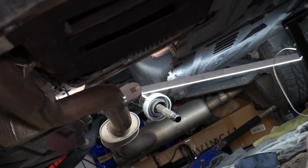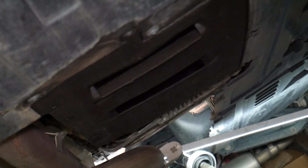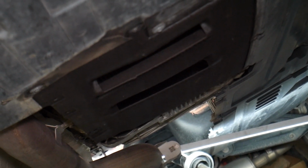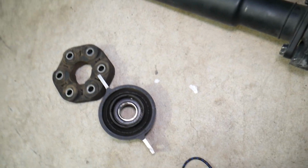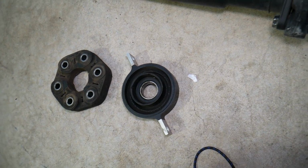Now we have the rear axle, it's right there. We installed a new bearing. In some cases you may have a rear axle that's bad, but if you remove all that stuff, you can easily inspect the rear shaft bearings and see if you have play there as well. But I recommend to always replace these two together, because they fail at about the same time as well.